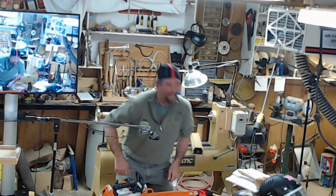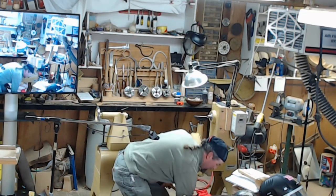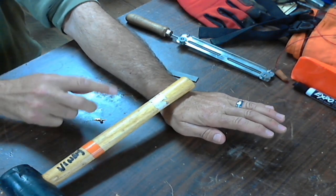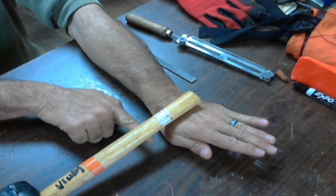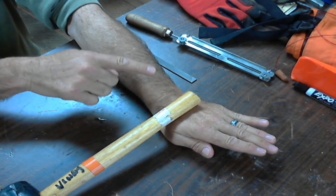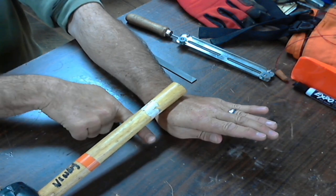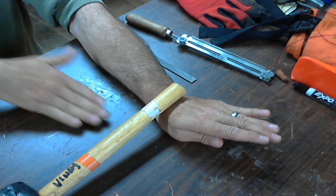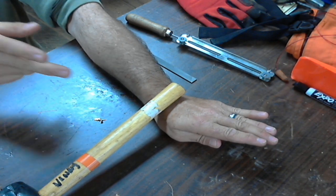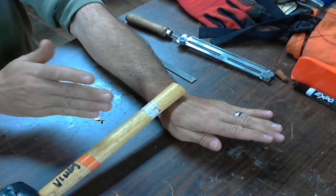Don't stand like here. The big thing is, you guys got to understand that there's pressure wood. It's hard for me to explain the physics of that. But if a tree is leaning over onto something and you cut down through the top of it, it's going to close in as you're cutting. It wants to generally fall to the ground. So your cut would actually be from the bottom up, making sure that tip is all the way in there and you're not using just the tip of the no-go zone. You want to be as deep as you can, and usually I try to start on an angle and then work the blade underneath it, and that's the one cut I'll come straight up with. And when I get to the top, start going a little easier, because you don't want that thing come out, catch a piece of wood and really throw it at you.